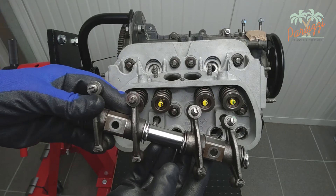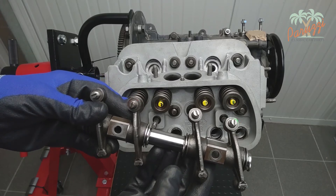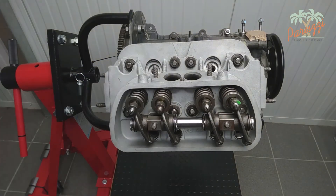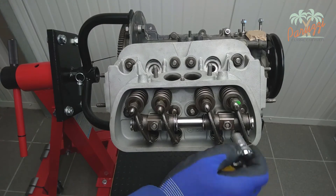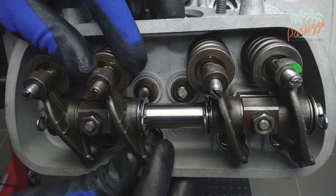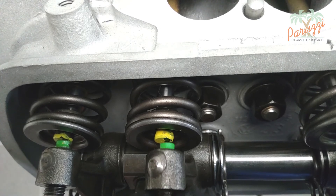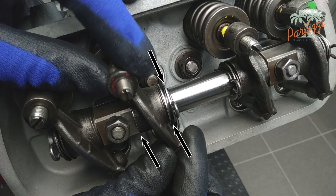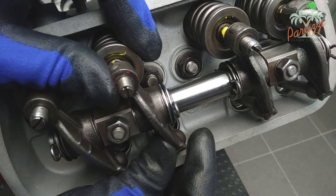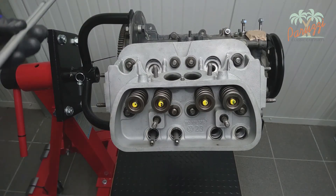Now you can reassemble the rocker shaft to test if the rocker arm we wanted to adjust is now correctly positioned. Here you see the thin shim to the left of the rocker arm and the two shims with spring washer between them. Tighten the nuts with a socket wrench — they should not be torqued to spec yet, just to check the position of the rocker arms. The desired result is noticeable: the rocker arm of the intake of cylinder 3 has moved to the right. The same axial play was maintained as with the original flat washers. If you are done shimming, reinstall the pushrods and then the rocker shaft.